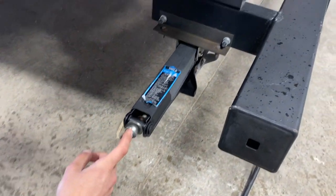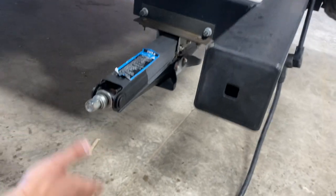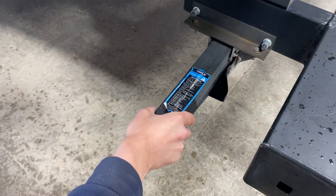In this corner, as well as in each corner of the trailer, you'll find these stabilizer jacks. They run down to contact the ground — give it another turn or so and that'll firm up the unit and get rid of any bounce or sway you currently have.